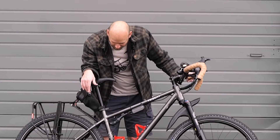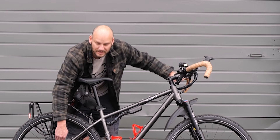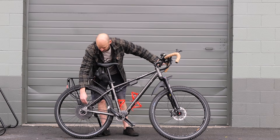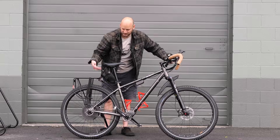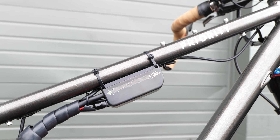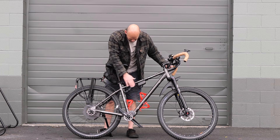If you want something that'll do 50 miles an hour, put a 72-volt battery on this and it's going to spin super fast. These also have different windings — I generally recommend the slow wind, which gives you more torque. That's what this one is, because if you want more top speed you just up the voltage. With this one, we're running a 52-volt 8 amp-hour battery pack. These batteries can put out 50 amps continuous, which is generally a good pairing with this motor system.